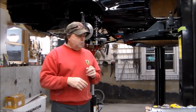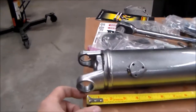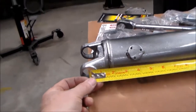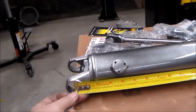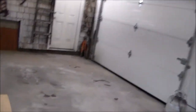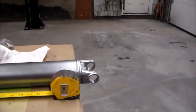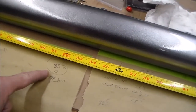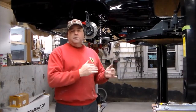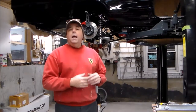Now I know exactly how long I want to make my drive shaft. Here's the drive shaft — I'm going to put my tape measure in the center of this bearing cup and measure to the center of the opposite bearing cup. That original shaft is longer than needed, so I'm going to mark it at 38 and a half inches. With our drive shaft measurements all made, I can take it down to have it cut to size — they'll cut it, re-weld it, and rebalance it.